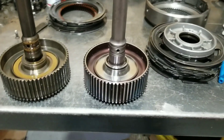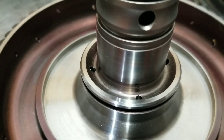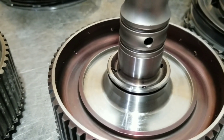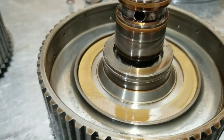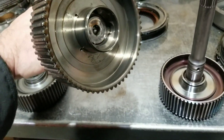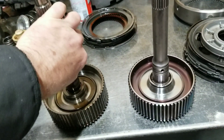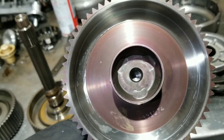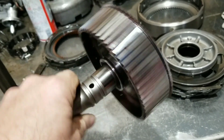You can see the differences right off the rip down in this area. See how it's one piece of the machine? Right down in here - that's where it's pressed. When you pick it up, you can see where the shaft is pressed into the center of the drum. The Sonnax is all one-piece, it's billet. They machine these things and it's incredible, the quality of workmanship that goes into Sonnax parts.